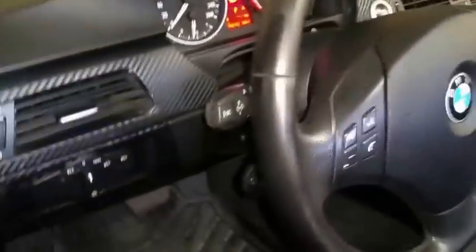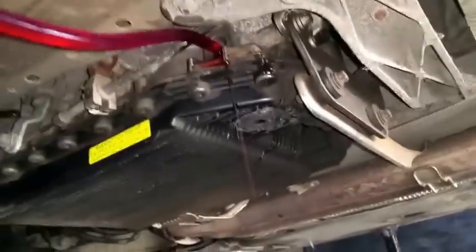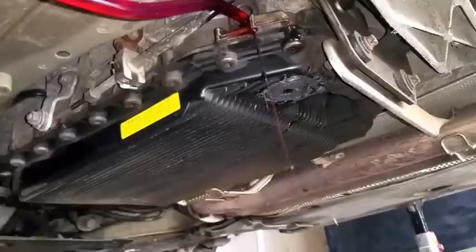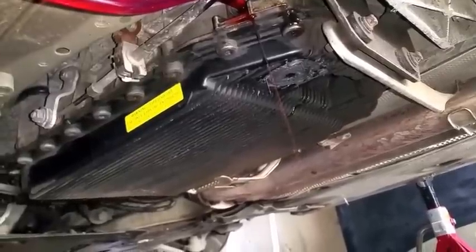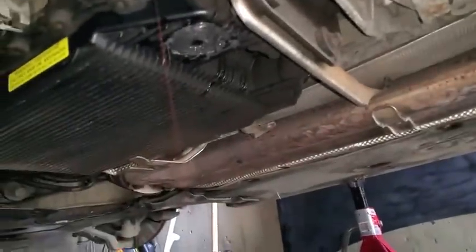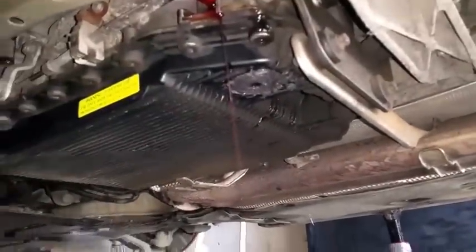Now we're at the final stage with the car running and after switching through all those gears. If you come down here, I have a stream of fluid leaking again — that means the transmission has enough oil, which is probably about 5.5 or 5.4 liters; in my case it was 5.4 liters. Now I'm just going to close down this fill bolt — the drain bolt is already closed — and the transmission fluid change is all done.